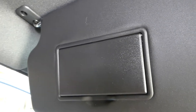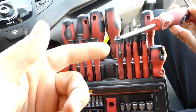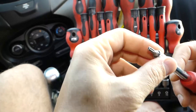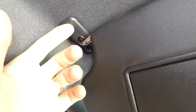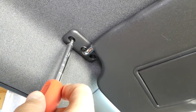In our case we don't have to deal with a wire, so I'll show you where the difference is. Some sun visors will use a Phillips screwdriver, some will use a Torx, and others will use a hex key. In our case it's Torx 20 — right here, you can see Torx 20. You'll have two or three screws, and sometimes they might be hidden under plastic caps, but on this Ford Fiesta they're just wide open.